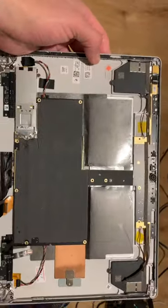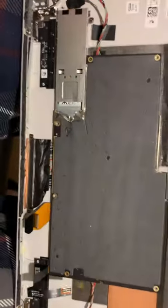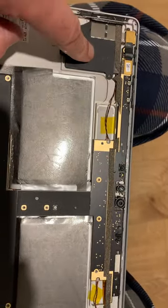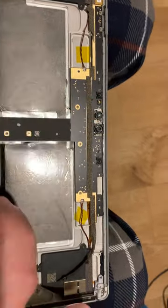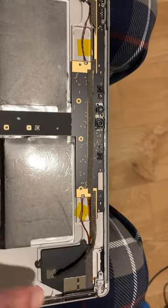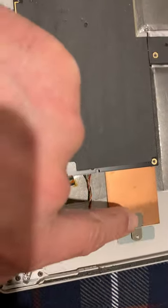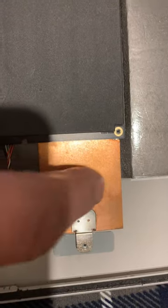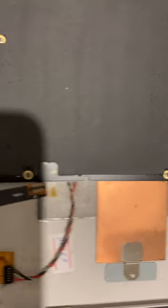So, purpose of this video, this is a Surface Book 2 outer casing with a Surface Book 3 motherboard in it, and it was interesting, should we say, to fix it. Surface Book 2, so it's the existing battery that was in this shell. Surface Book 3, because that's new, that's a piece of metal that attaches the heatsink, which sticks out a bit now and makes contact with the body. I'm assuming that's some new heat dissipation techniques that they're using.